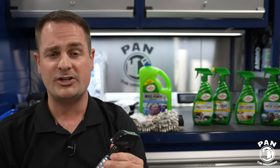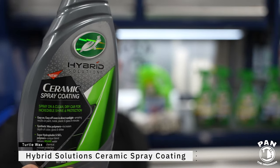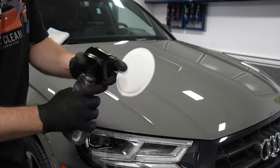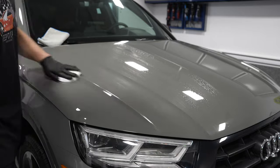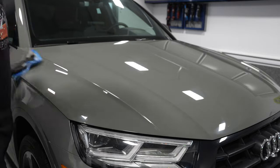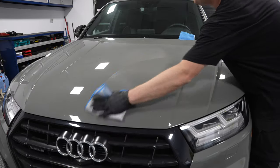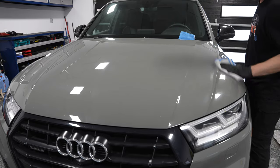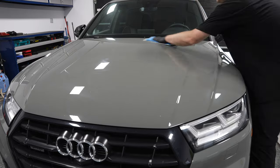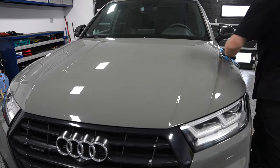Now that the car has been fully washed and dried, we're ready to apply the ceramic spray coating by Turtle Wax — from their Hybrid Solutions line, which is their top-of-the-line protection. The application is very simple. Shake the bottle well, open the sprayer, and then you have a choice to apply it on a microfiber applicator pad from the Pro Elite Series at AutoZone, or use a microfiber towel. Apply one to two sprays per panel max — do not oversaturate the panel, as that's when you run into streaking issues. Apply in a crosshatch pattern — up and down and left to right — working in small two-by-two sections. Then take a second clean and dry microfiber towel and buff off to a streak-free shine.